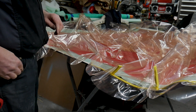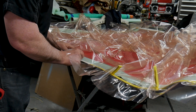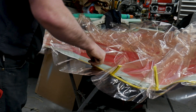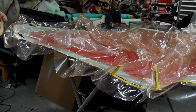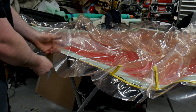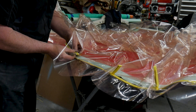Again, leaking molds — if they will not hold the vacuum for 24 hours at least, depending on your infusion resin, do not infuse them. You need to find the leak. There's no such thing as not finding the leak. I mean, I guess you could probably get away with it, and from time to time I've had something tiny that's worked, but it's generally pretty bad practice. When I watch the videos from everybody else, it's just throw the pleats in, throw the bagging material on, oh everything's fine. I've spent hours and hours making sure that my layups with the bagging materials are accurately done — it takes a lot of time.